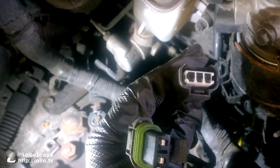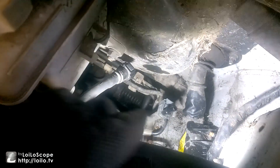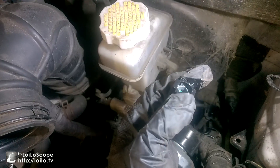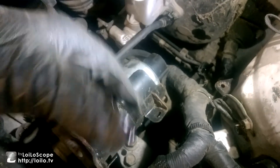That's a push-down clip. That one is also a push-down clip, and this one sits in and it's underneath, so you pull down on that and then pull back. You'll get the electrical plugs off that way. I've already gone ahead and disconnected the fuel line on this side — as you can see it's disconnected. Down below is where it was connected to. Push on either side of those and that releases the clip — the inner one is always more difficult. Once you have that out, bring it over to the vice.